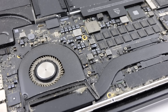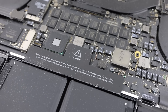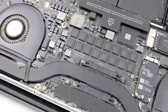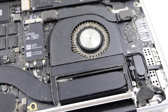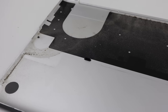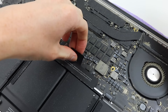The back came off with a small dust cloud, but now that we're in, we can take a closer look at the insides. Frankly, I am shocked to see this amount of dust and grime in my laptop. While I did purchase it secondhand, in the time that I've owned it, I wouldn't say I've used it in any dusty environments. The fans and vents are caked with dust, seriously impacting airflow. Even the bottom plate we just removed is filthy. In fact, the dust marks show how the air is circulated and drawn in from the side vents. But it's now time to take some action and get this MacBook Pro looking nicer and getting better airflow.